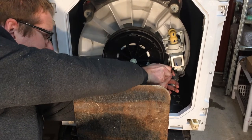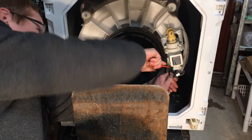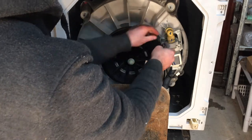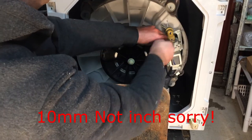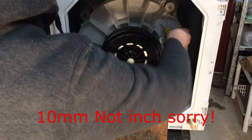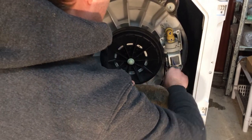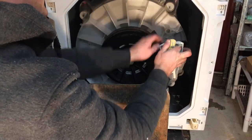Not putting too much tension on this cable — there we go, that's out of the way. For these screws we need to use a Phillips with quite a large bit, at least a number two Phillips, possibly number three, or I prefer to use a 10mm socket. The two top screws we need to take right out. This bottom one we don't actually have to undo all the way — we undo it partway, then release that clamp, pull the top of the pump off, and it lifts off.